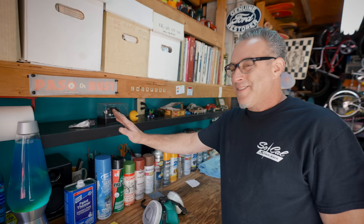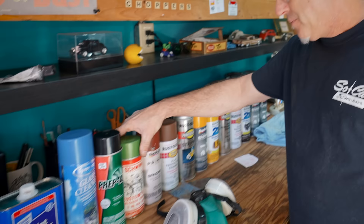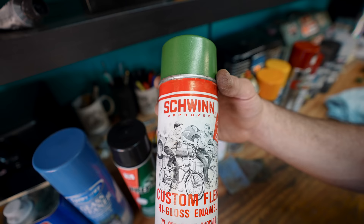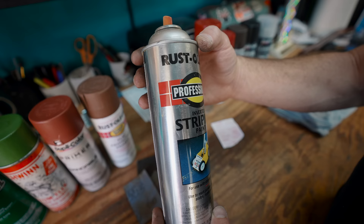One of the first things we're going to use is some paint thinner, which takes off paint. I'm going to clean some of the parts and the frame with glass cleaner, and then also prep all — you can use it before you paint to make sure the surface is completely clean so the paint sticks. This is like vintage Schwinn paint — we're not going to use it, but this was what Schwinn offered. Red oxide primer was popular to leave a hot rod in.